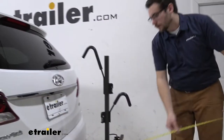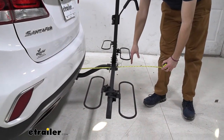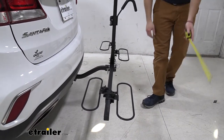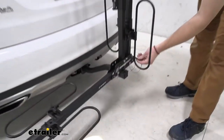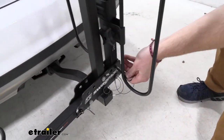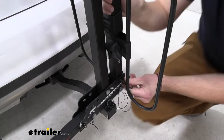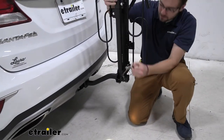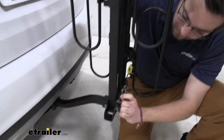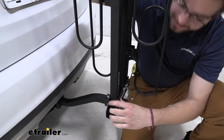Let's see how much length we're working with on the back of our vehicle. Unfortunately, this is going to be a pretty static length — from the back, that's putting us at 19 and a half inches added to the rear of our vehicle, and we don't have a way of folding this in to reduce that length. All we can do is fold these arms up. To do that, simply unlatch that pin. Make sure your handles are tightened down all the way. Slot those in, same with the other side. This shows you the storing position you'll predominantly find yourself keeping this in, and it makes it really, really easy to store almost anywhere.